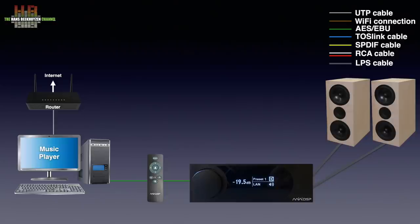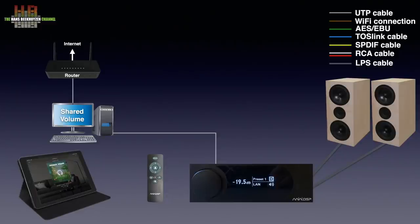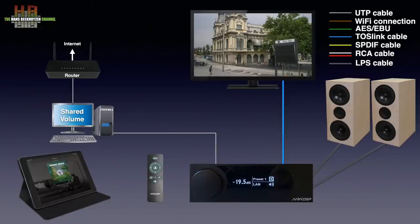More handy might be to have the computer elsewhere in the house, like in the study, and connect it to the SHD Power over the network. That way the acoustical and electrical noise of the computer won't bother you. The built-in streamer of the SHD Power lets you play music from a hard disk shared on a computer. Music is chosen using a smartphone or tablet. You can connect your flat screen using a Toslink optical cable to enjoy better sound quality over your stereo.